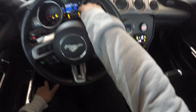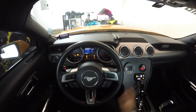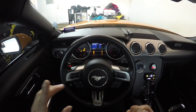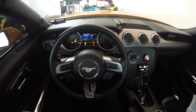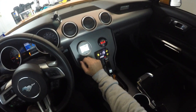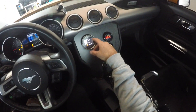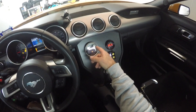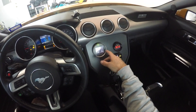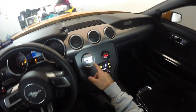The reason the traction control, ABS light, airbag light, and tire pressure monitor are all on is because all that stuff has been unplugged. I unhooked the ABS plug up front which removes traction control and ABS, unhooked the airbags because of the harnesses, and obviously I don't have any TPMS sensors in the car. We've got the N-Gauge — I need to change some of the things I have logging since I was messing with it, but typically I have boost pressure, oil pressure, lambda, and temperature on there.